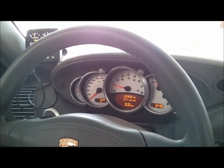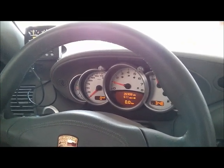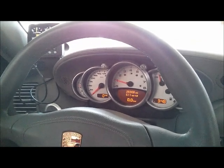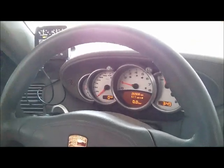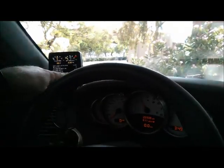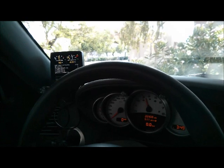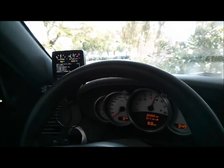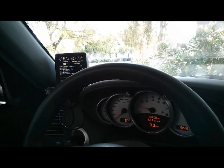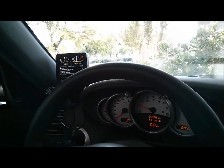First thing first: if you've got your foot on the brake and you push the cruise control back into the set/accel position, as you can see it'll show you what boost position you're in on both the dash and on the display. If you're holding it long enough, it'll cycle up — so it goes to four, five, and it'll reset. When you cycle the key, it'll go back to wherever your base was.